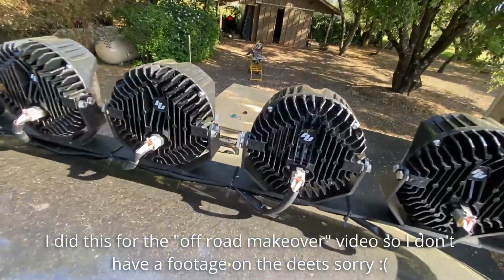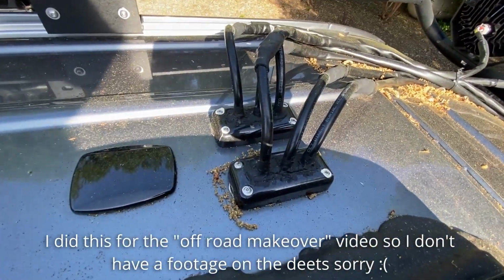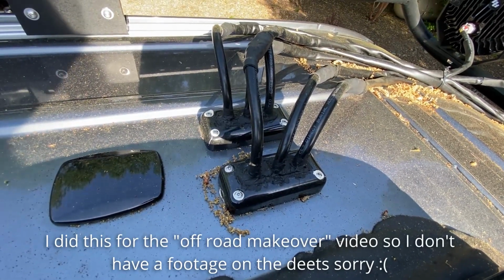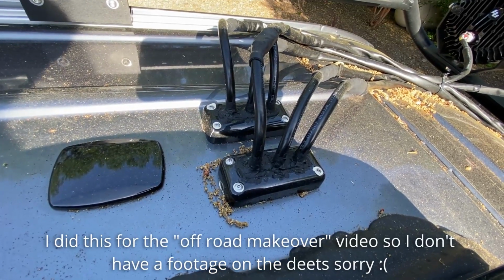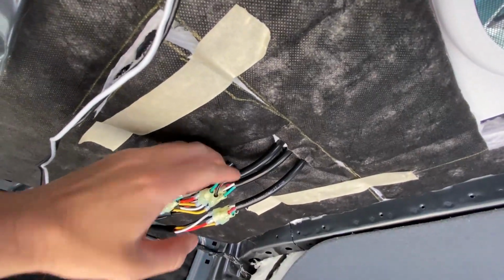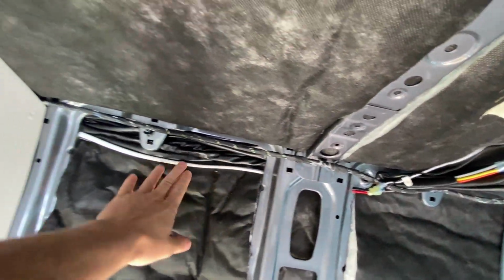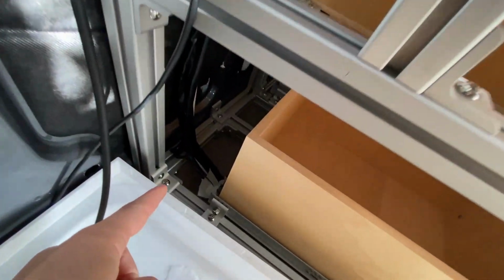It's a little dirty up here right now, but we have our 6 Baja Designs lights. We have them attached with the waterproof connectors, and then they go into these cable clamps directly through the roof. I put a little Sikaflex on top of them. I'll put a link to these cable clamps in the description below. I think this is the best way to run wires through the roof of the van. They go through the roof and come out through the insulation right here. We have them running back inside of the wall here into our cabinet, where we have them run down, and then out through the cable boot.